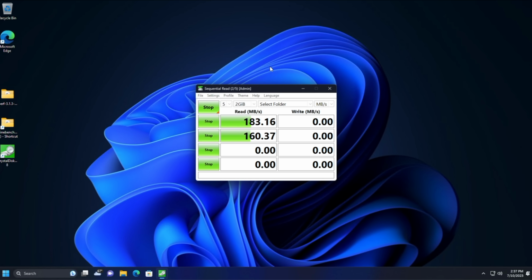see how the network performance is on the 2.5 built-in gigabit Ethernet. Well, I can't quite saturate a 2.5 gigabit on the read side, but when we get to the write side, it actually performs better than it does on the reads for some reason. And we're getting about 300 megabytes a second out to the network, which is actually somewhat over what the 2.5 gigabit Ethernet would be spec for, so I'm not entirely sure how accurate that is, but it seems to be